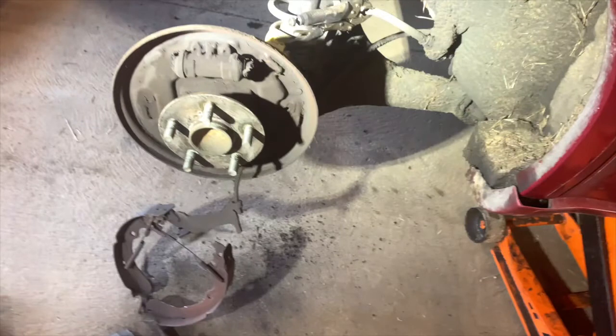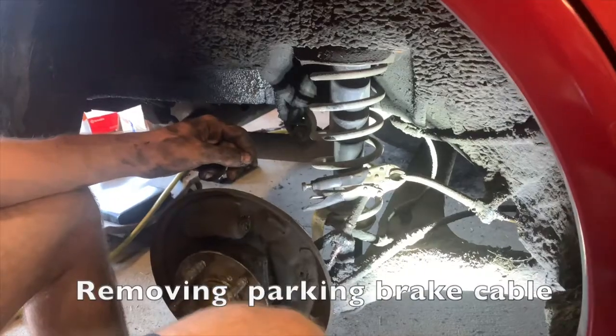So most of this clip is me struggling to get the brake line off. I live in Northeast Ohio where there's a lot of salt on the roads and the brake lines are seized into where they flare into. So my brake line ended up bursting, so in this instance during the install the clips kind of get choppy because I need to have my friend remake my brake line while I'm continuing the process of disassembly and reassembly of the wheel hubs. Hopefully if you live down south or have taken your brake lines off before, this process will go a little more smoothly for you, but in this instance everything just fell apart due to corrosion.